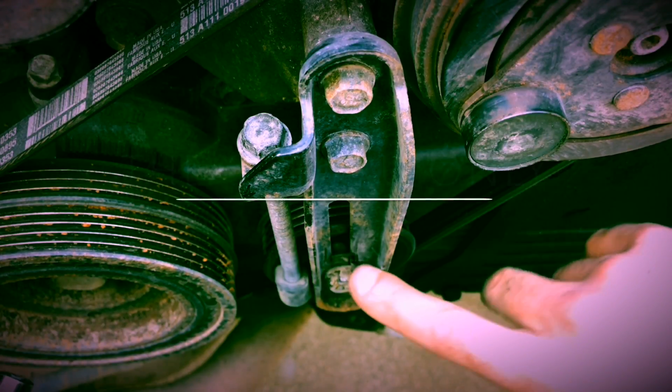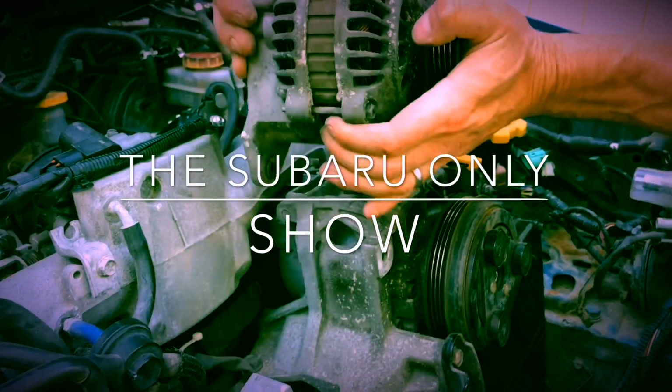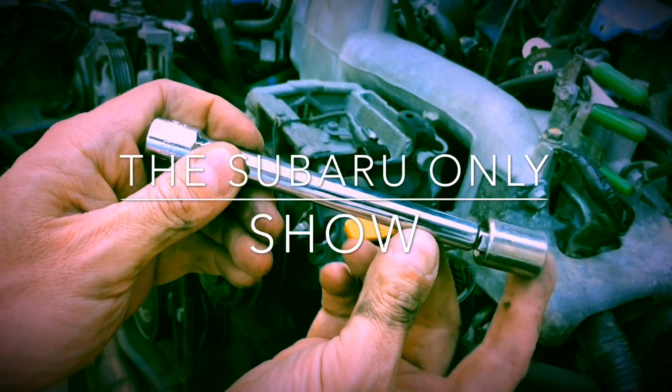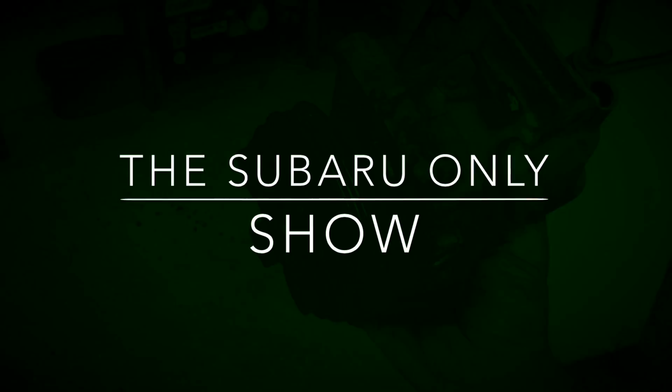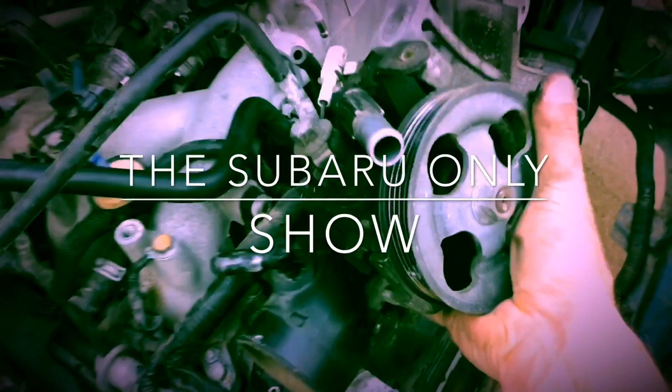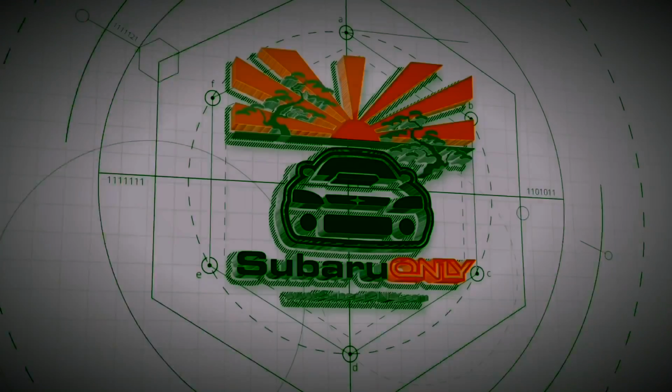So that pulley can slide up and down that slot. Alright, we got both belts done. Alright, now is the alternator. An extension with a wobble fitting will actually make it a lot easier. Throw that sucker with the other parts. You should be able to lift it up and out of the way. And just like that, we are done with another step from the master list.